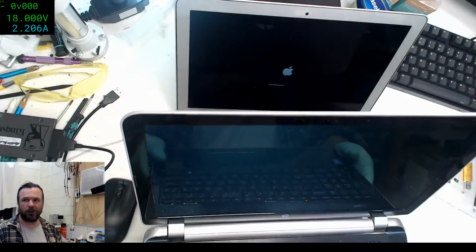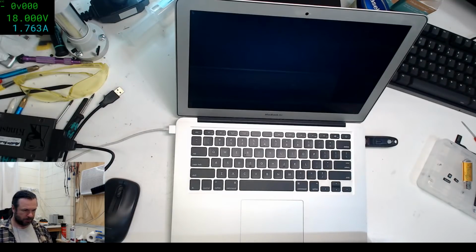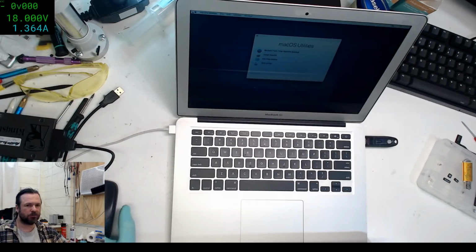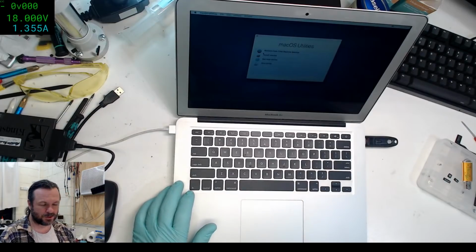So I find it very, very annoying with Windows how it defaults now to being a fast sleep. So whenever you're trying to shut down properly, you can't, not by default. And so you have to really work your way around trying to get the damn thing to shut down properly. So you hold down the shift key, shut down anyway. Yeah, I know you have to disable Windows Fastboot, but you have to get in there first. And if you don't know what the password is of the customer, because they've forgotten to give it to you, you can't even go in and enable the administrator through Linux because you can't mount the file system in read-write mode.